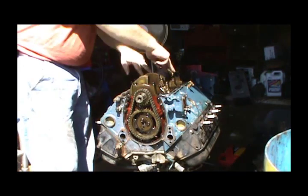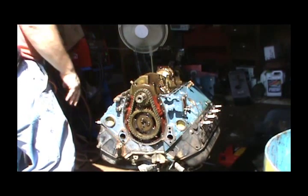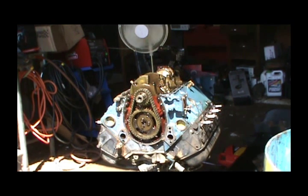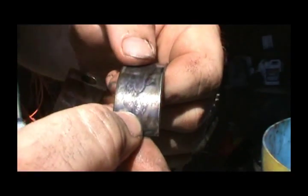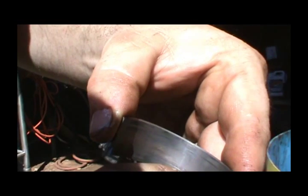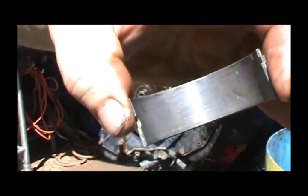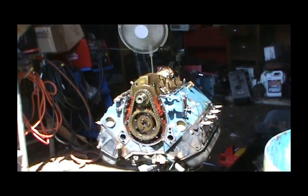This is a four-bolt main — two and two. I'm going to pop the rod bearing cap off. Alright guys, here is the rod bearing. It's a production bearing and I believe that S is standard. It's got some scoring in here — it just had dirty oil in it. I can feel it with my fingertip — it's scored. I ain't real happy about that. But I am happy that it's a standard crank. It's not too bad a shape — I can polish it out if I wanted to.